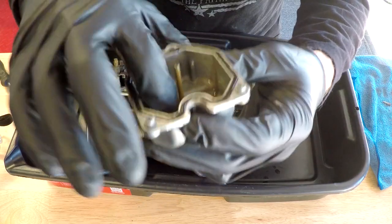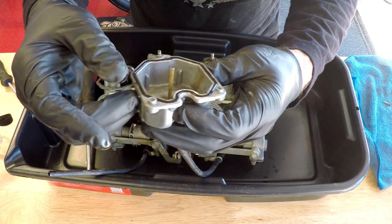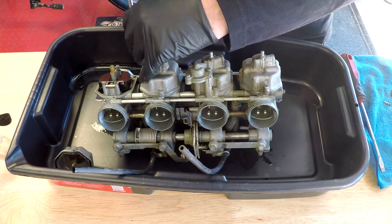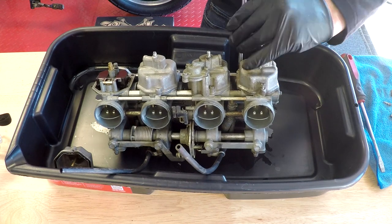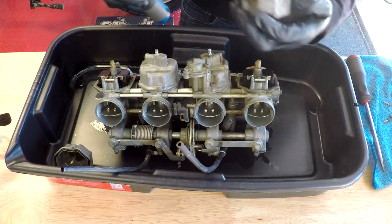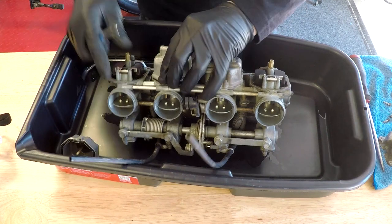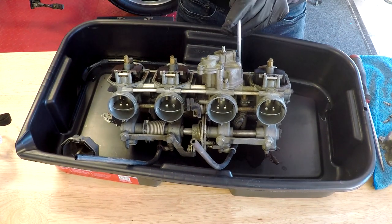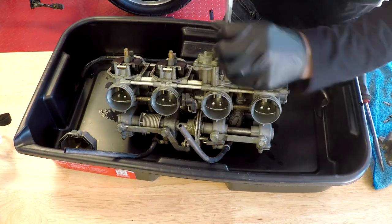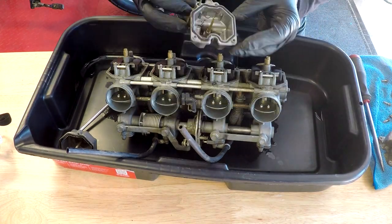You can see there's some discoloration in there — the gasoline doesn't look very fresh — so it's probably a good idea to do a rebuild on this thing and get in here and clean it all up. We'll put the float bowls back on, hit it with some carb cleaner to get it super clean, hit it with some little brushes, then mask off where we don't want paint, and then spray paint. It's that simple.